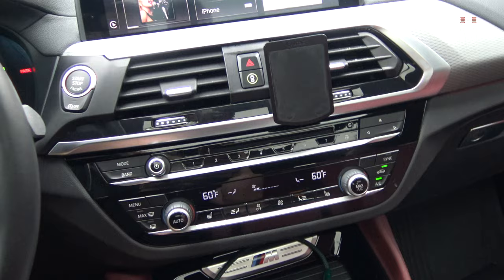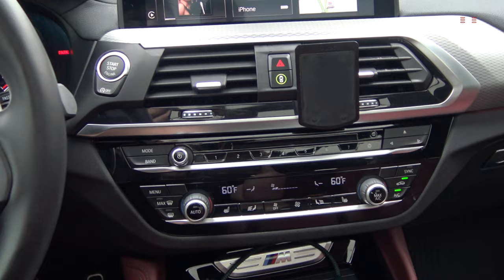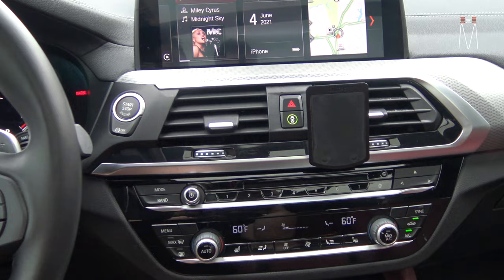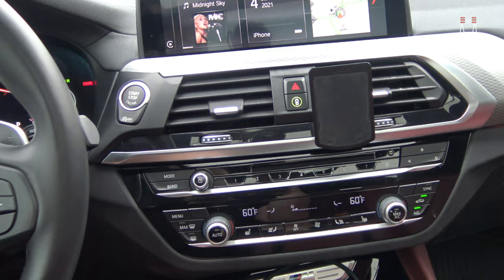However, anytime that you have a car with a factory interface that can give you a good signal, that Bluetooth source becomes less imperative. Obviously, if we have a car like, say, a random Lexus in which there is no amp interface, that Bluetooth module becomes very imperative for very good audio. You're only going to get what the source can deliver at the end of the day.